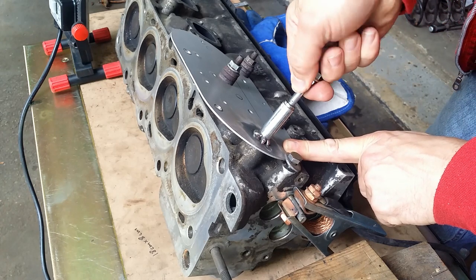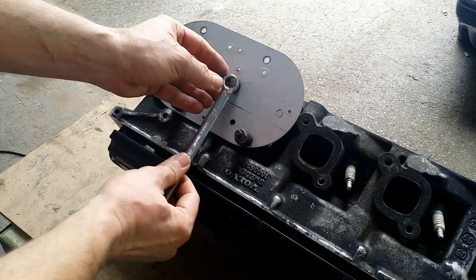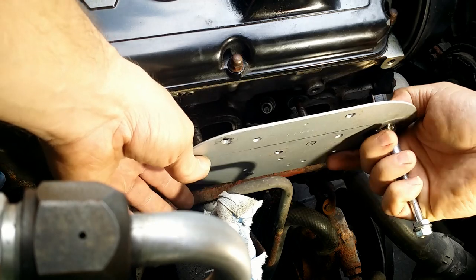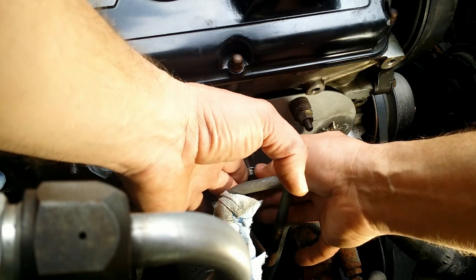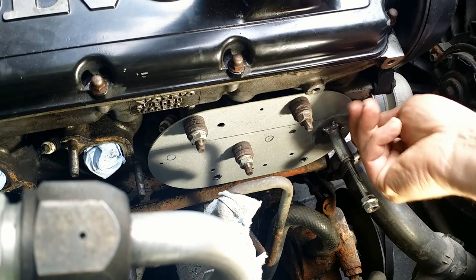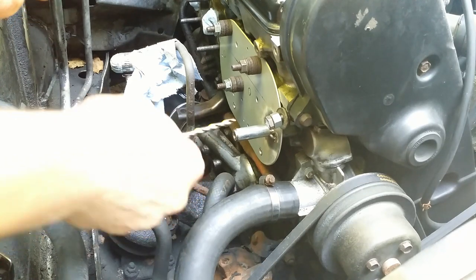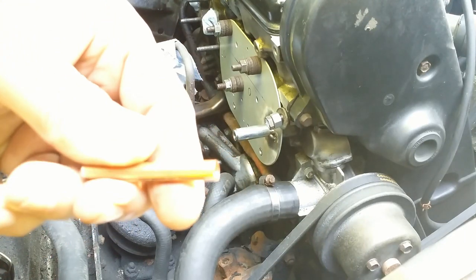Okay, goes deep into the head, no problem. Let's move it to the car. I use this extra bolt at the end of the plate to hold it flat to the surface. I hope that quarter-inch drill will be enough to fish out the remaining threads after drilling. The opening in the bushing is 17/64. Quarter-inch drill is too loose. This copper sleeve corrects the problem.